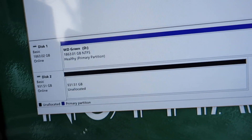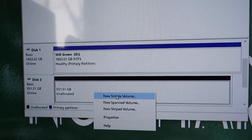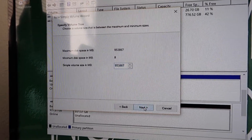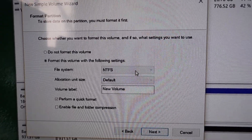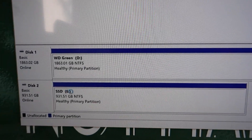If you do not see this, I recommend going into the BIOS of your motherboard and look through the boot record — it should show all the drives the BIOS knows are there. If it shows your drive but you're not seeing it in Windows, that's better; that means it's at least not dead. I just had to reboot Windows a few times for it to recognize the disk. So now just right-click and create a new simple volume, go through the wizard, use all of the space, choose your drive letter, select Next, use NTFS, and change the name — I'll just change that to SSD — click Next, the wizard will go through, and then all the space is usable.